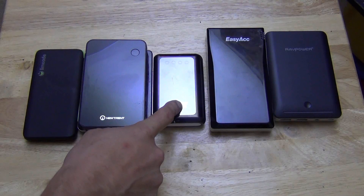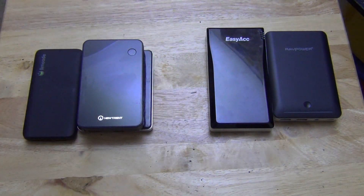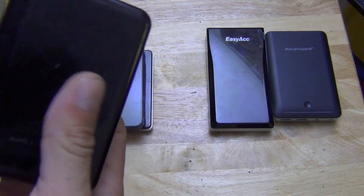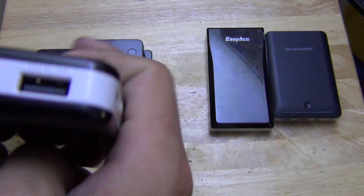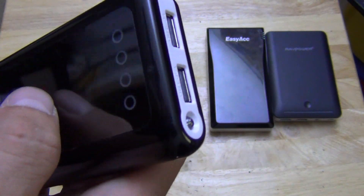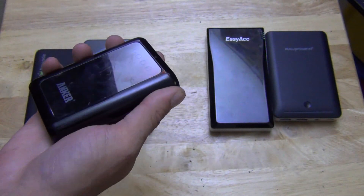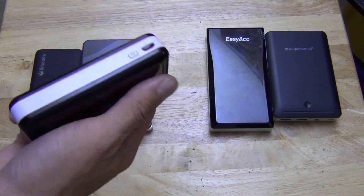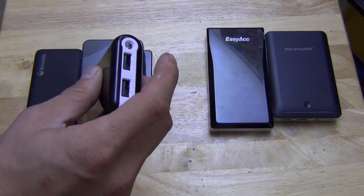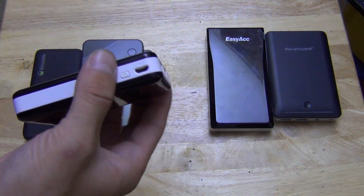This is one of my favorite backup batteries — this is an Anker, and it's 8,400 milliamp. It's currently $36. It has a 2 amp output and a 0.6 amp output. You can charge smaller devices like a GoPro with the 0.6 amp, or older phones or whatever. It's also great for camping with USB lights and fans — putting them in the 0.6 amp port is awesome. The 2 amp is good enough for smartphones, so that's really nice.